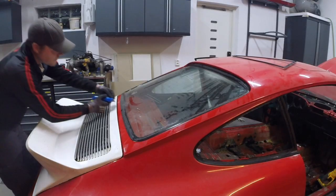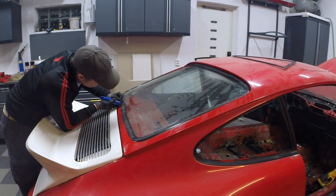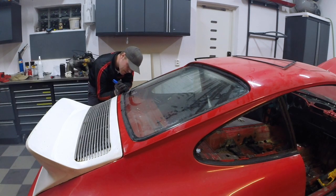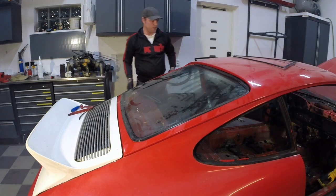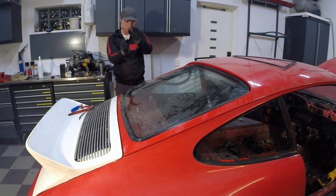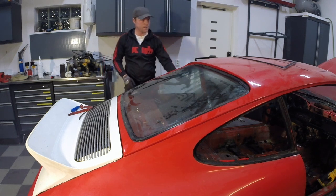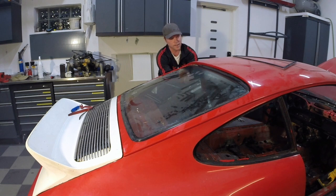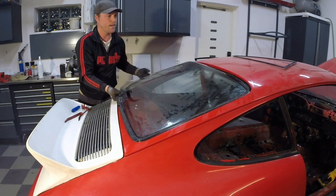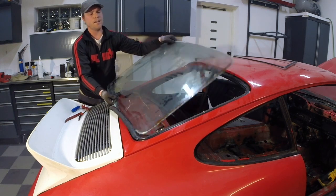I don't think I'm doing myself any favors with this approach, so I'm going to see if I can cut it from the outside and just lift the windscreen out. What I tried next was really just sectioning the seal — putting the carpet knife on towards the glass and pulling it gently down. This corner is up now. I actually pulled the seal down under it, so if I pull here I'm actually just going to tear the seal. Don't break — got it.